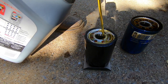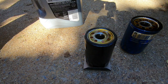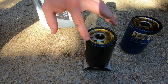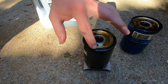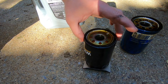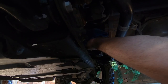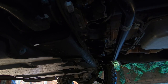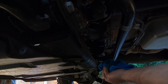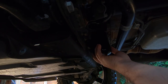If you don't pre-oil the filter, when you crank the truck it's bone dry and has to filter through before oil can run through the rest of the engine. So I like to do a little pre-oil. Since this filter is mounted vertically you can actually fill the whole thing up — unlike horizontal-mounted filters where you'd spill it. You definitely want to oil this ring so it makes a good seal. Then take a clean part of the rag and clean off the mounting surface for a clean slate so it seals properly.